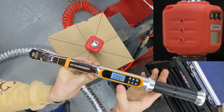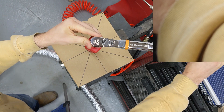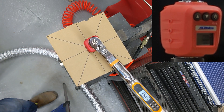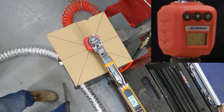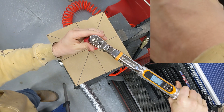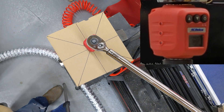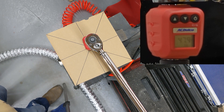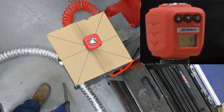To start out, I have this set to 50 pound-feet. Turn our adapter on. Okay, so we're off a little bit — about 4 foot-pounds with the GearWrench. Let's see what the CDI tells us. 47.9. So, off by 2 foot-pounds.